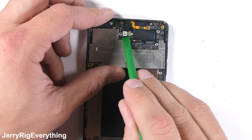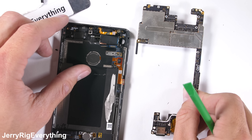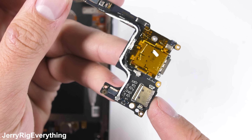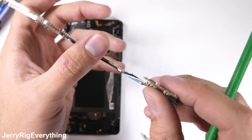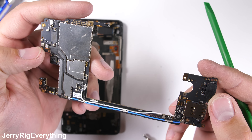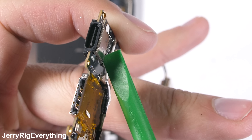The whole motherboard can pull up and away from the phone body. It's a bit disappointing to see the USB-C charging port soldered onto the main board, making it not replaceable. But to be honest, now that charging ports are reversible, there are fewer physically damaged charging ports from people accidentally plugging in the wrong direction. So an attached charging port is not as big of a deal as it used to be — still not ideal though.